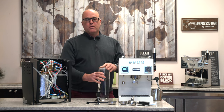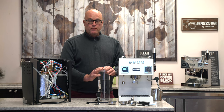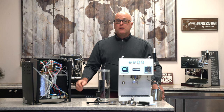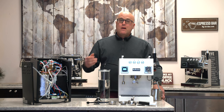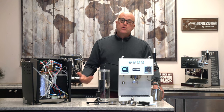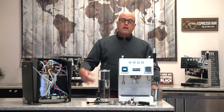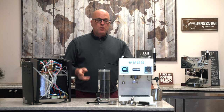Just remove it and fill up the reservoir. As far as water, you want to use soft water. You don't want to use hard water, which has calcium and magnesium. You also don't want to use distilled or RO water — reverse osmosis or any type of purified water — because you can't extract the minerals out of the coffee grinds, and it can become corrosive to the machine. It also tends to build up some type of green film, which is similar to limescale.